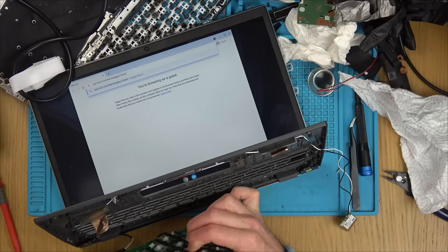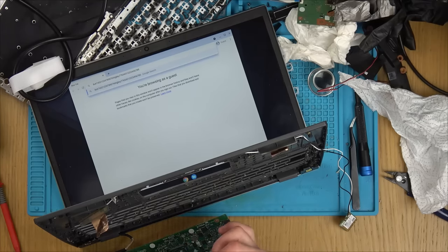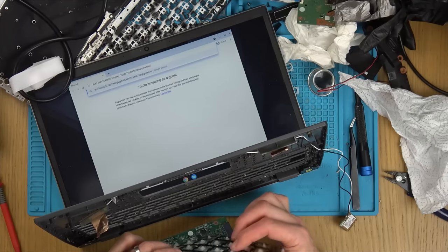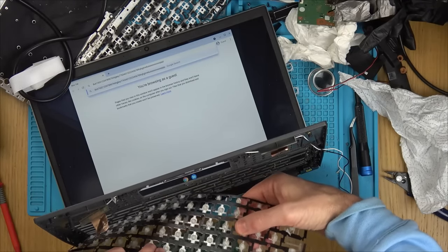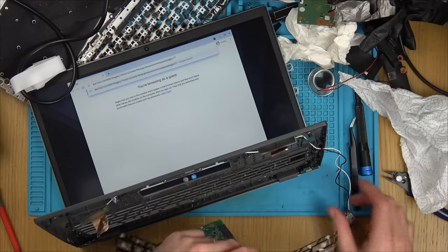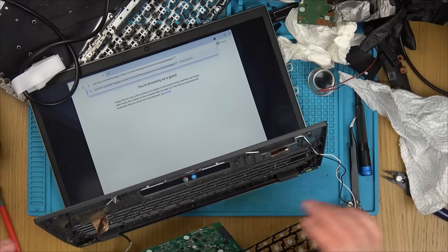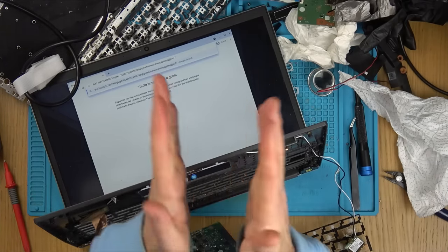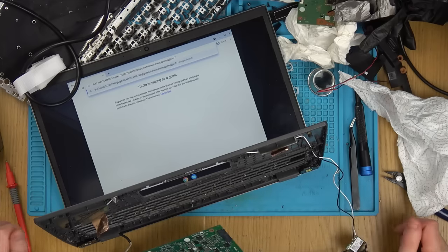Physically pinching the two membranes together gives me five or six working keys now, but still lots that aren't. Well, that has given me hope — we've definitely proved what the fault was. Whether every key will work, I don't know. I think it's worth the risk of putting it back together — you can see it is definitely typing when buttons are pressed. Three hours have gone by and it's a complete nightmare. Too many clips are broken. I could buy plastic scissor clips for the keys or look into another keyboard assembly, but you have to buy the whole assembly — over £100 new, or a faulty one for £30 with unknown problems. So it's a failure video.